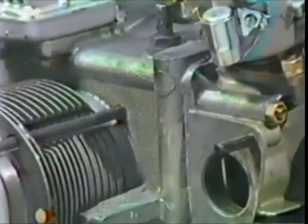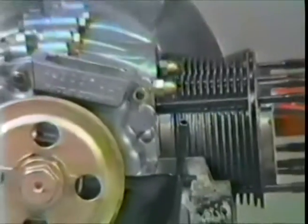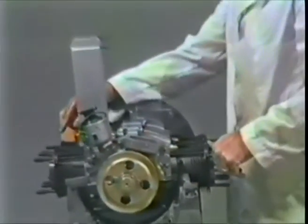Okay, so now the next thing to do is install cylinder heads. I like to start with the number 3/4 side. Use the best cylinder head for the number 3/4 side. And you have to tip the engine up to do that and actually rotate things a bit.